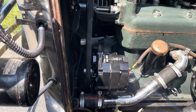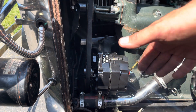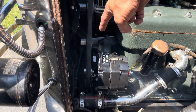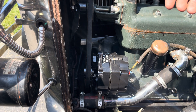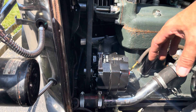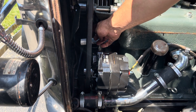When you go for the reinstall, put your bottom bracket back together like normal and have that straight. Then take the new Nurex bracket and it goes into the middle of the timing holes. Back out the 9/16ths-inch bolt, put in their bolt, and set the original 9/16ths bolt aside for later. You'll still want about an inch of play in that belt on the passenger side — that's about right.